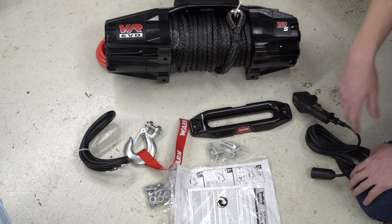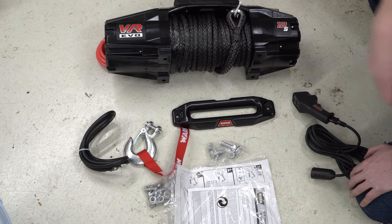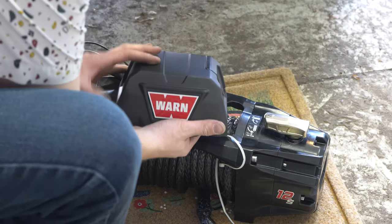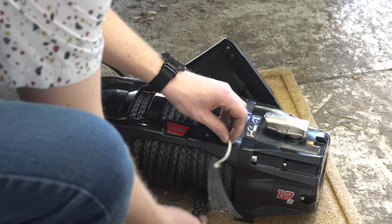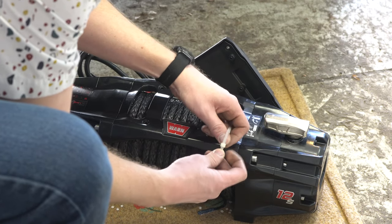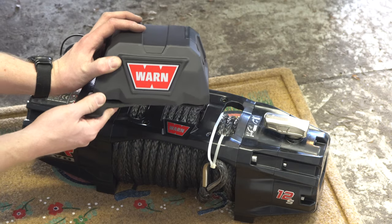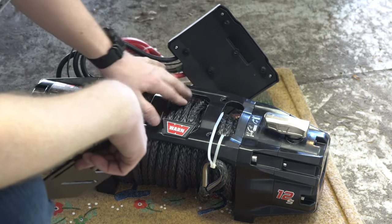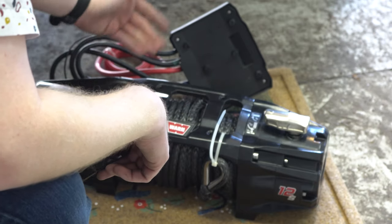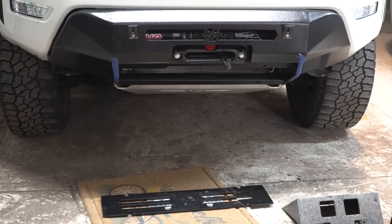It's a synthetic cable, so maybe that's why we don't need the rollers on the fairlead from the factory. Comment below if you know that. Removing the electronics from the winch is really simple — you take out these four 6mm bolts and then four 4mm bolts. They have nice instructions showing you how to do that. My zip tie was loose enough to reuse. For my particular installation I have a bracket I'll be using with my bumper, but I wanted to show how easy that was. Everything lined up nicely — super simple. I really appreciate how easy Warn has made all this, though I really wish the Warn sticker was straight on this.